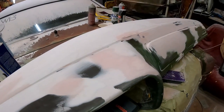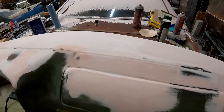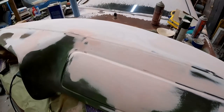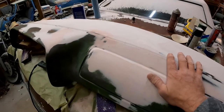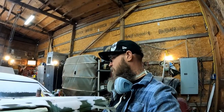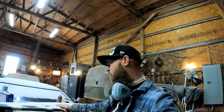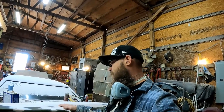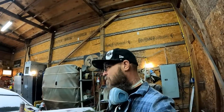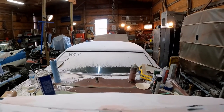I think just a few more hours cutting out defroster vents and gluing on some vinyl, and we will have this thing good to go. But we're going to have to do that on the next video — this video is getting way too long. A lot of y'all like to see the process without a bunch of time lapses, and I wanted to really show you guys what's all involved in this. Again, if you're not going to cover it, don't go with Bondo — go with fiberglass or something like that. But be ready, you're going to be sanding a lot longer than a weekend. That stuff is no joke — ask me how I know. I already went through it on that gigantic roof. It takes forever to sand, but it's really, really strong.